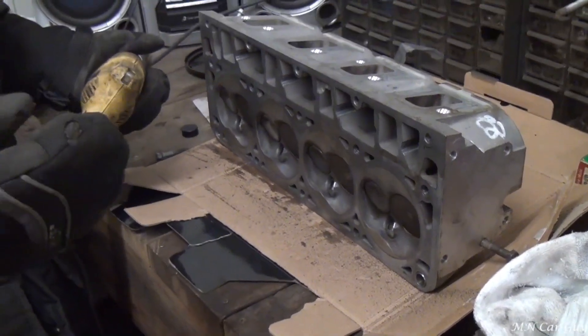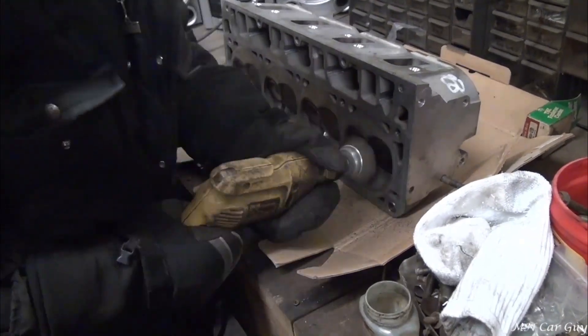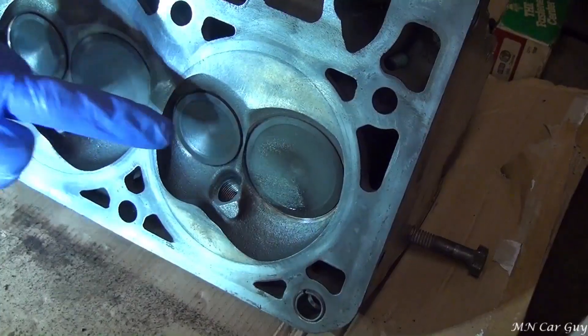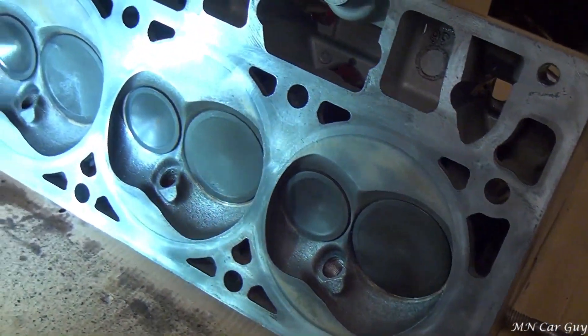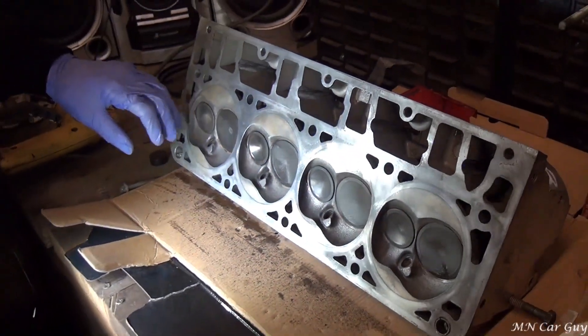It's not going to remove it — it actually shines it up. Whereas an abrasive will do it, but since we're talking thousandths of an inch on the flatness of this thing, I prefer removing it with the wire wheel. If you have any carbon that's built up here on the faces of the valve, that can create hot spots and can damage the valve eventually. So the idea is to get that off of there.